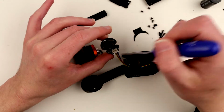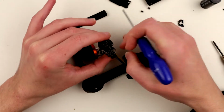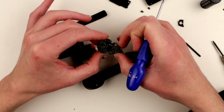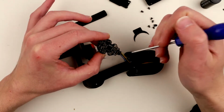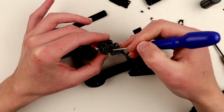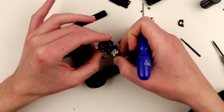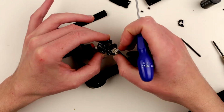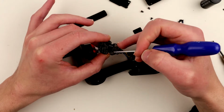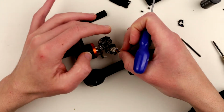Interesting. So those are probably motor drivers, and this guy is the microcontroller. So essentially, this totally looks similar to quadcopter motor controllers. But this is too overkill, having the ARM Cortex M3 here. Usually motor controllers for quadcopters just have some Atmel kind of part. This one is overkill, so I don't know, I have to continue and understand a bit more about it.